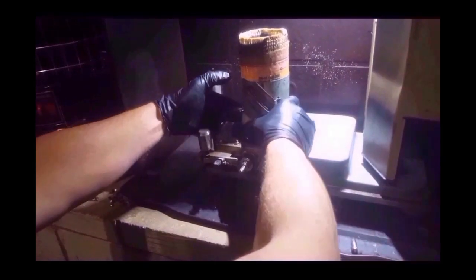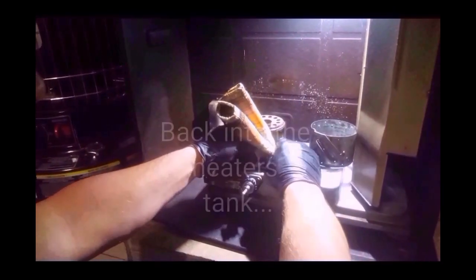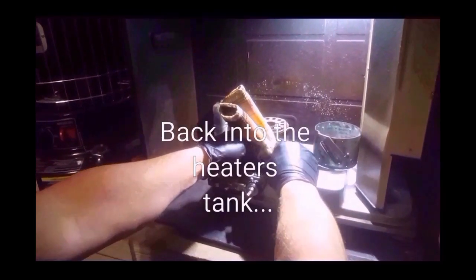Pull this wick up, let it sit here for a minute. Kind of give it a little while to fall down to the bottom of that wick, so you can push what kerosene's left in it out. Wring it like a rag. Then once you got most of it off, go ahead and pull it on up. Fold your wick in like that on one side. So you want to kind of put it on that edge right there and just squeeze that kerosene out of there.